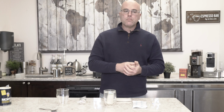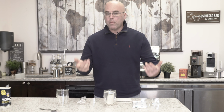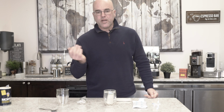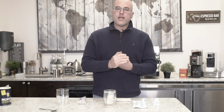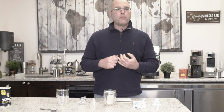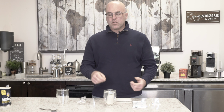Up until a year ago, in 2019, we would recommend replacing this once a year. We changed our opinion and our minds. This should be replaced every 6 months, just like the filters in your refrigerator or your filtration system. Typically, you have to change the filters every 6 months. And the reason is, you want to avoid mold buildup, fungal buildup, bacterial buildup that can happen in the cartridge. So it's really important to replace it every 6 months.